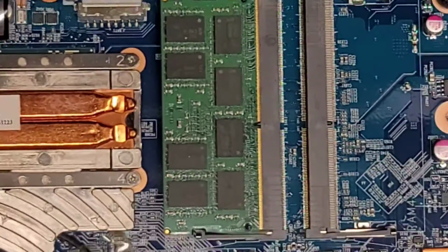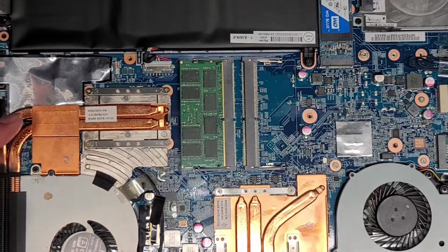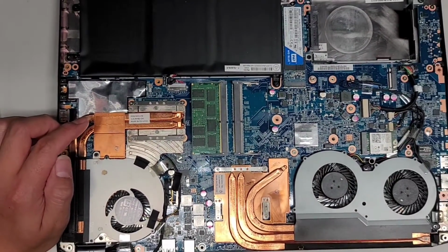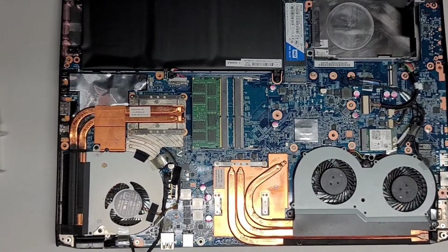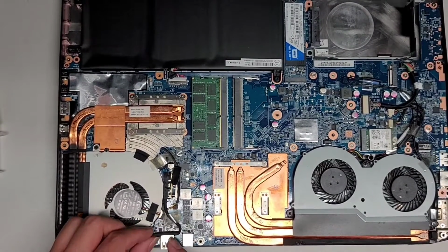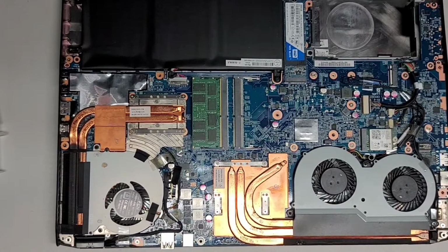If you do attempt this, make sure that you disconnect the battery, then open the computer and press and hold the power button 10 to 15 seconds again. You don't want to risk shorting something out just by trying to fix the problem you already have, then you'll end up creating an even worse problem. Once you do that, put the LCD LVDS cable back and make sure it's taped into place.